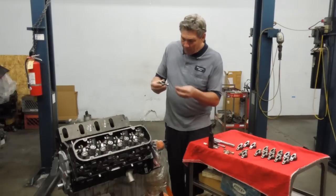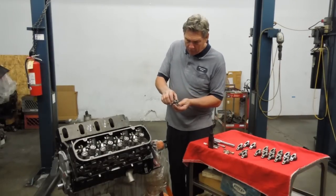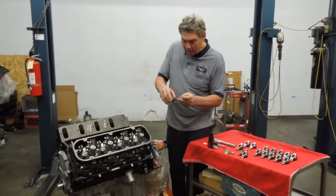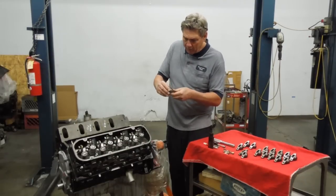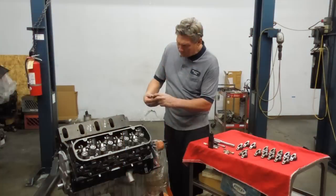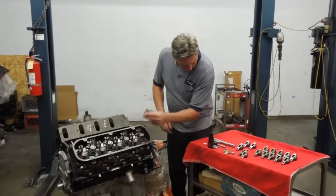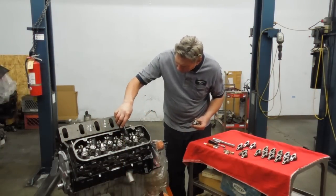These little nuts have to fit into the relief that goes right inside here. If you put the trunnion on backwards - which you can - it doesn't put the nut in the right place. So you need to make sure that you have this flat section in here for the nut to fit on and not the unmachined side. There's two sides: unmachined and machined. You want the machined side up because it works with the roller rocker arms and the nuts.